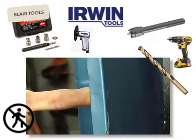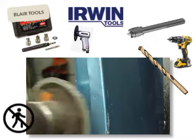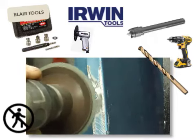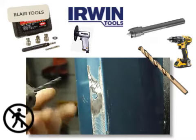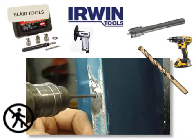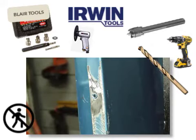Alright, let's do it again. The next spot weld is directly above the last one. Again, we grind it flat. We do this to make sure there are no imperfections in the weld. Then drill your pilot hole in the center or as close as you can to it. Remember, this is a special bit. It does not walk on you. They are made by Irwin. I don't work for Irwin, I just like the product. We follow up with the Blair cutting tool. I don't work for Blair, I just like their product.